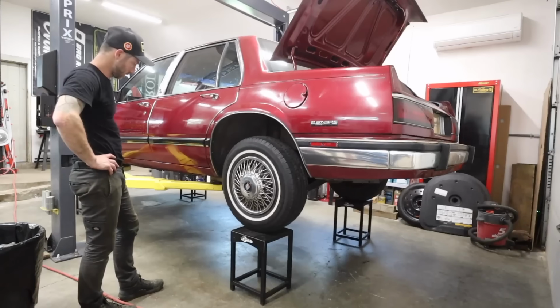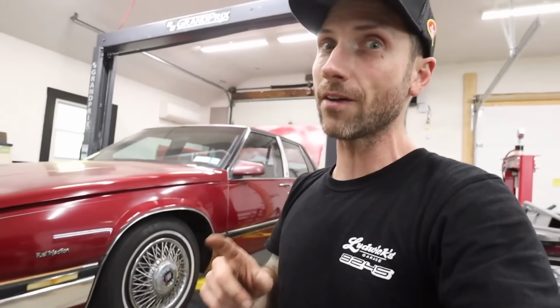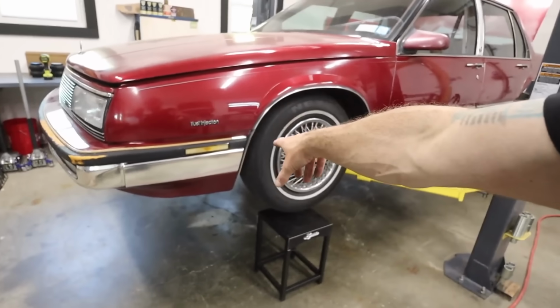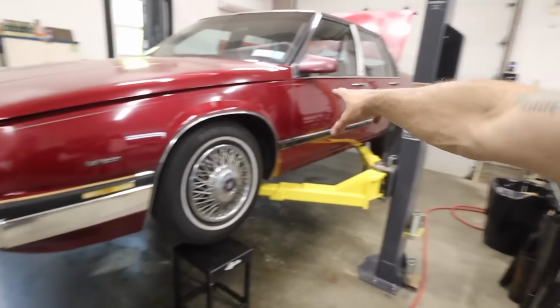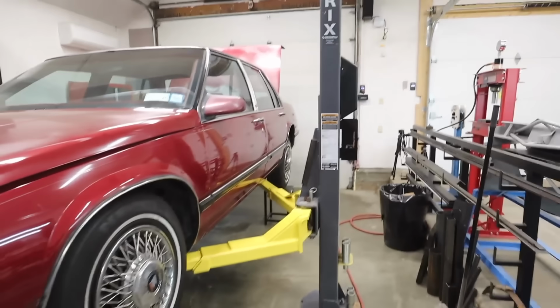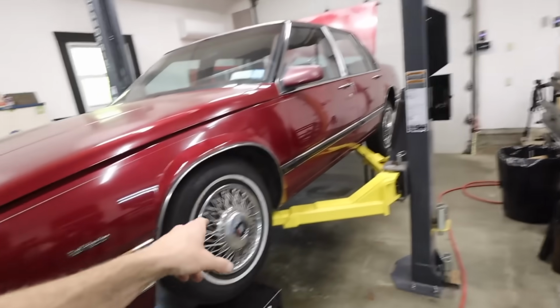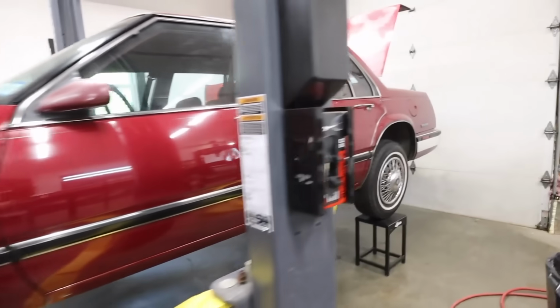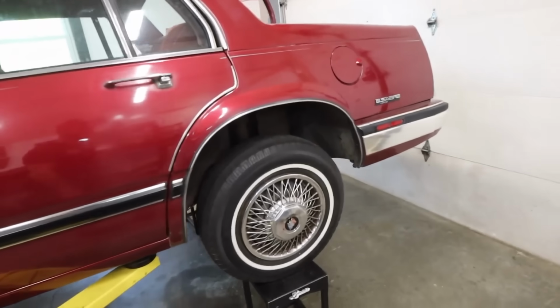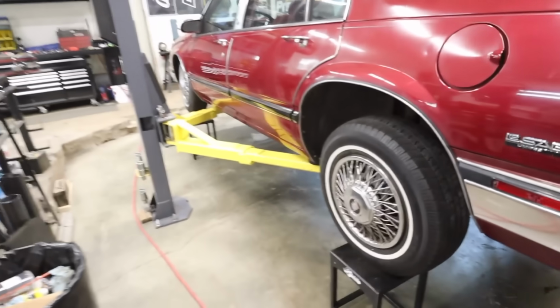No way. The reason why we have this kind of lift is because I'm only going as low as the stock shock in the rear will compress. Because of the wheels we have, the fitment I want, and for how low the car will go with the engine cradle in the front, that's all we need in the back, right? We don't want reverse rake. So we're gonna have far more lift in the rear than the front. Full droop in the front, full lift in the rear. We will be stadium seating in this car driving everywhere.